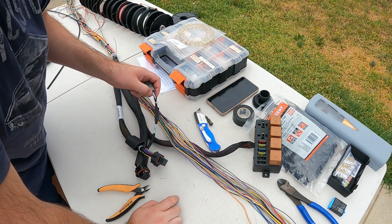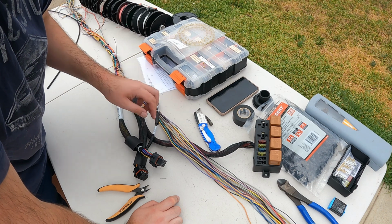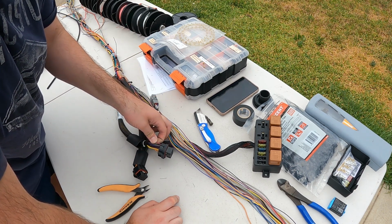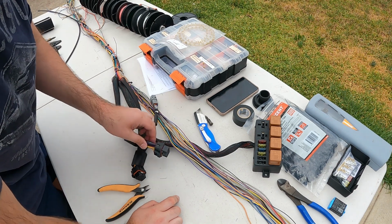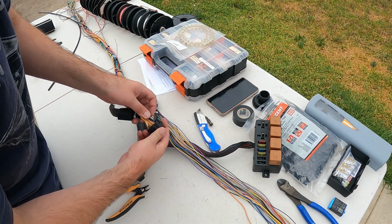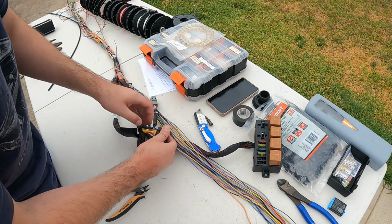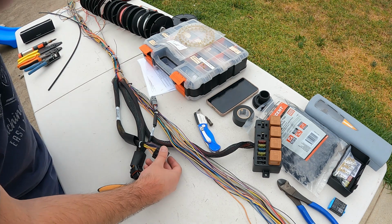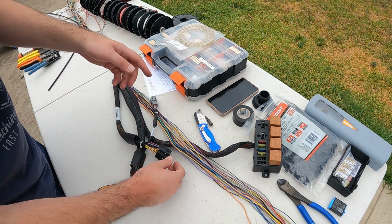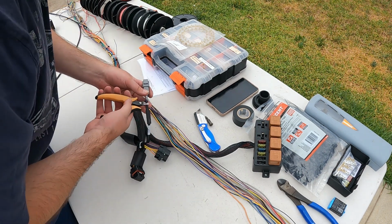So we're going to cut out this 12 volt grey red. We're going to splice into this one, and also we're going to splice into A10. I believe it is A10. Yep, which is that one there, which goes to battery ground, somewhere up in the loom here, which we're going to put onto a cylinder head. Alright, so yeah, we'll start chopping this out.